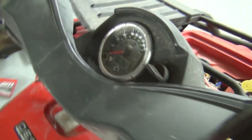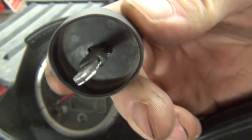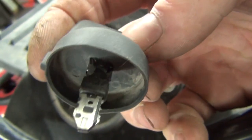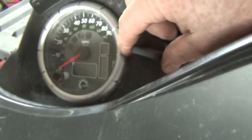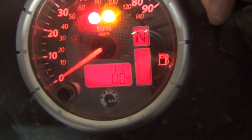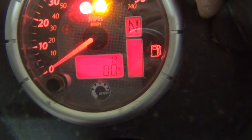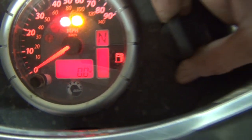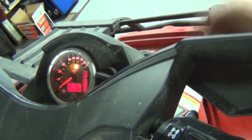One other indication that I had that the key was actually still good - besides being totally destroyed, it's made out of plastic and tin foil. Look how twisted and jacked up that is. However, it does still work. When you turn it on, it says the original owner's name. It says check engine for one, and then something along the lines of 'Hi Thad Eakins.' So if it recognizes the owner, it's probably not the key that's the issue.